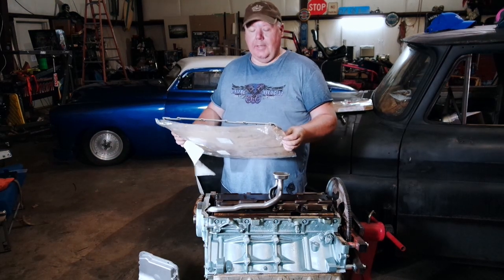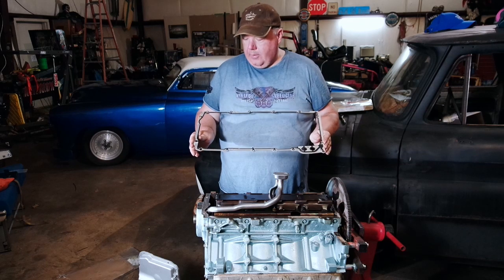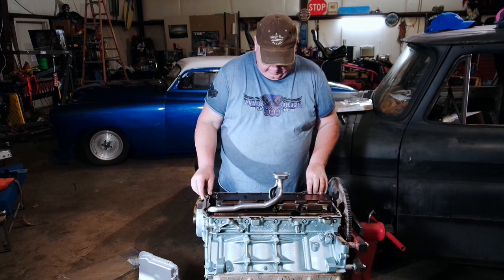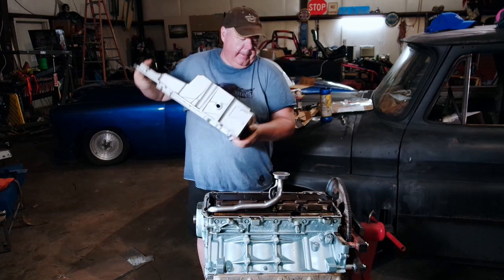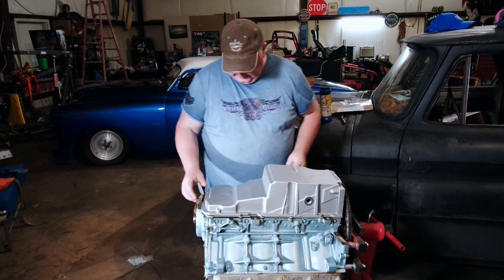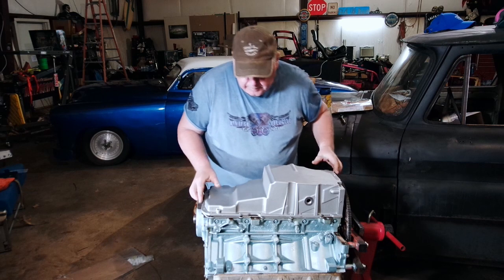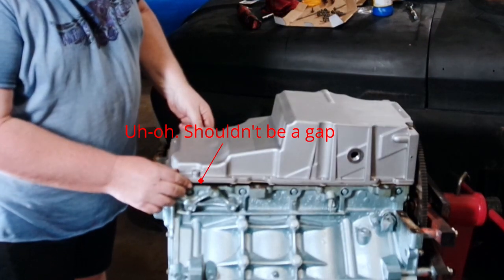Next up on the list is the oil pan. I am using a GM oil pan gasket — not a Fel Pro or anything like that, it's actual GM. This gasket requires no gasket maker. However, you do want to make sure your surfaces are free of any junk and debris that will cause your gasket to not seal properly. It only fits one way, so we are just going to set this in place and set our new oil pan in place. Now this oil pan and a lot of the parts I'm using came from Walter Racecraft — he is a really good dude and a wealth of knowledge for doing third-gen F-body LS swaps, and that's pretty much all he focuses on. His link to his site is in the description.